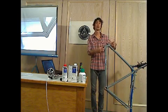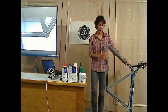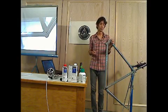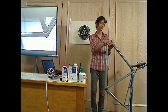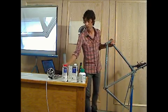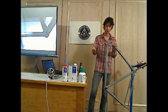You couldn't do this because it's so polished. That's another thing: before you prime, you want everything to be really coarse, so you would either sand it or sandblast it. You don't want anything you're painting to be too polished for it to stick. Nothing would ever stick to this. That's the whole thing with paint. This primer sticks to anything, even small children. That stuff is crazy.